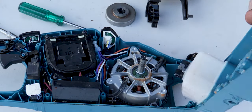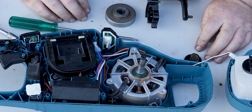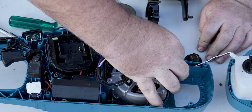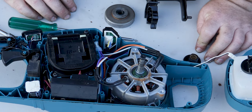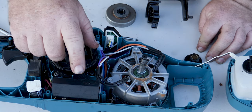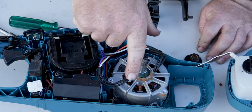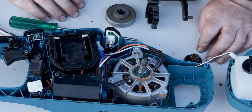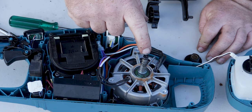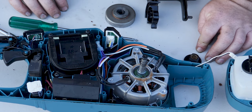Now we're into the meat of it. Here's the 200cc oil tank and here's the motor. You can see for a DC motor it runs a few leads — three on each side — so as I said before, it's basically an AC motor running on DC. The controller board is down the bottom, and it takes the DC and pulses the motor windings. It's a three-phase AC motor running from DC — fantastic and very efficient.